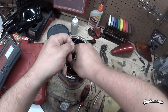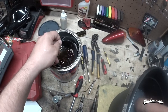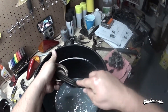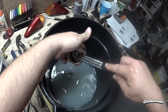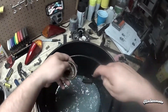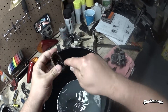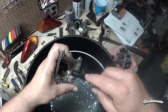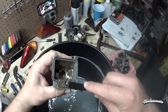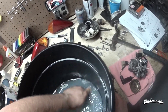Got the big bucket — let that drain out. Take our little bowl; the cap can go right in. Let those sit for a couple more minutes. Getting most of the surface rust off. This part doesn't see any gasoline, so I can hit it with a fine metal wire brush. The bowl we need almost spotless, so we need to get that gunk out of the gasket spacing.